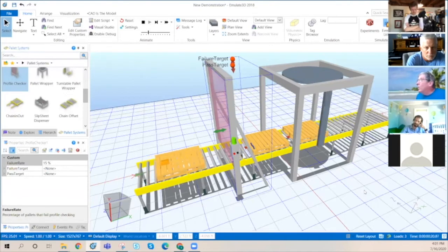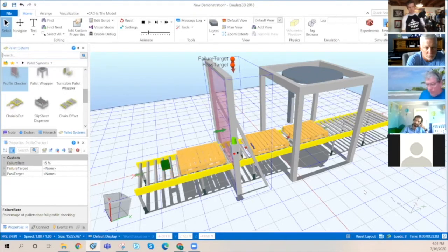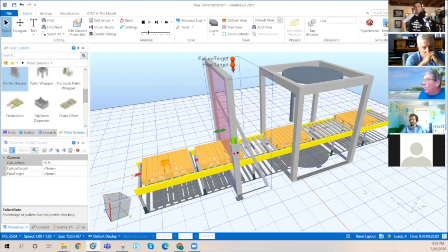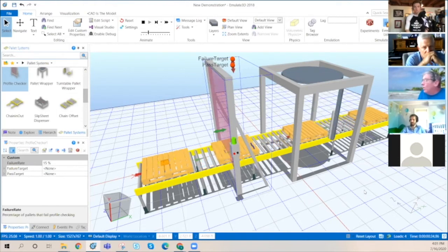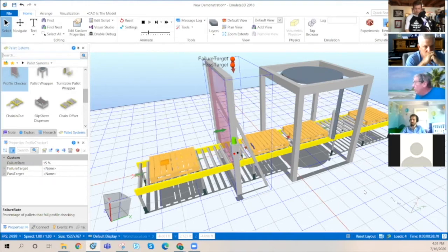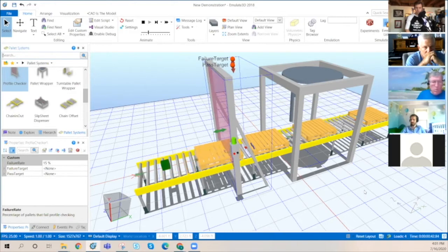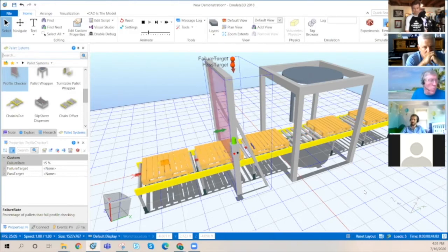So to answer the question, yeah, an engineering desktop or laptop, in what we'd call a gaming computer, a hot gaming computer, runs just fine. We recommend faster cores rather than more cores because nobody in the world has yet discovered a way to do discrete event simulation in multi-threaded processes, so it runs on a single core no matter what. But a lot of the stuff we do will take advantage of the multi-threads.